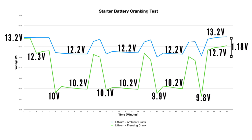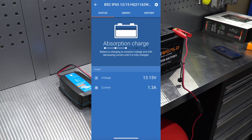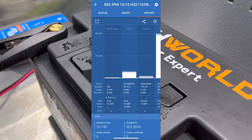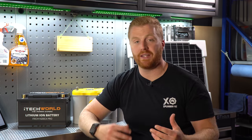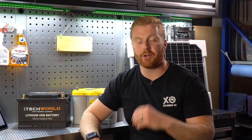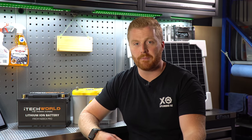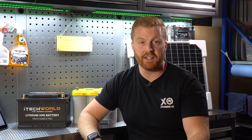Not only are the voltages lower but the variance between the minimum and maximum voltages on each test are increased too — going from a range of 1.18V on the ambient test to a range of 3.39V when freezing. Plugging the frozen battery into the lithium charger, there is no problem in accepting a strong 15A of charge. This test confirms that the lithium makeup and the BMS within the unit can withstand minus 20 degrees Celsius. Overall, both batteries performed quite well. The average voltage drop for the AGM was only 0.086V whereas the drop for the lithium was 2.29V — the lithium is definitely more affected by the cold, however it still turned over the big 4.5L V8. If you live in cold climates, more testing may be required, but in Australia we're never going to get to minus 20 so we should be right with this unit.